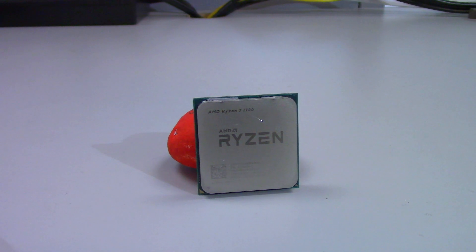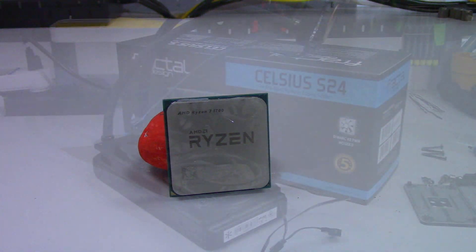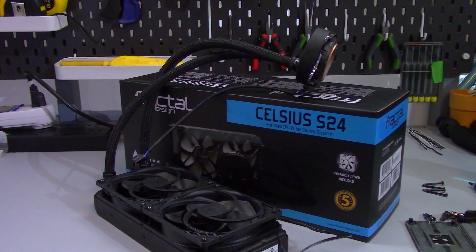So is push-pull worth doing? It really comes down to what you're looking for. If you're looking to have better temperatures, I don't think the added cost is really worth it. But if you're wanting lower acoustics, I think it has more to do with the relationship between the CPU and the CPU cooler. The Ryzen 7 1700 was running at 135 watts to the package, and the Celsius S24 could easily handle that with just 2 fans, so adding 2 more fans would be a waste of money. Now if you had a 3950x, this might be a different story — more like the AC12 with this Ryzen 7 1700, which did receive a small thermal benefit in the dBA-normalized test, and that would allow you to lower the fan even more to equalize the temperature. Whether the sound level drop is worth the added cost is something you'll need to decide for yourself.